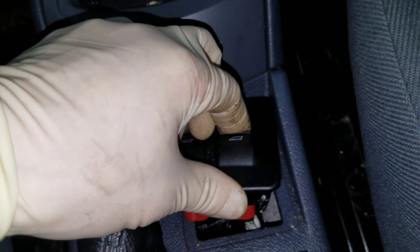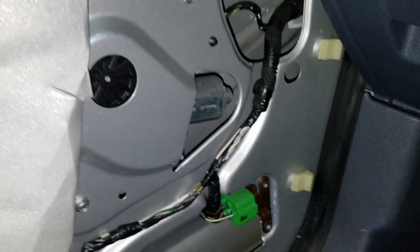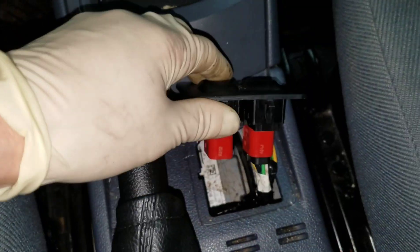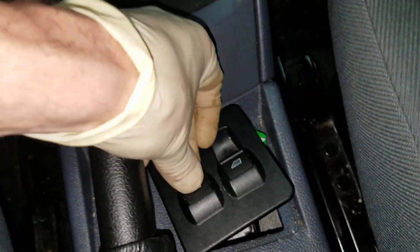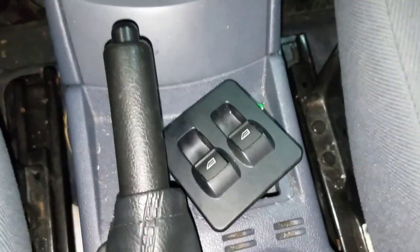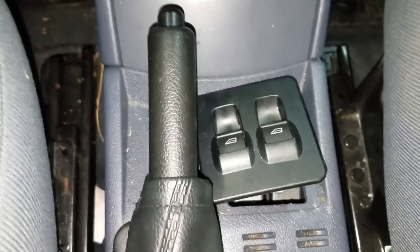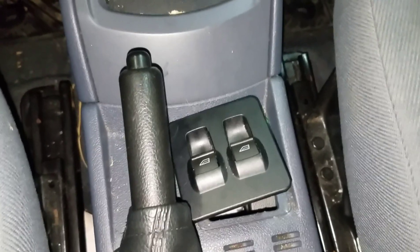We're going to go ahead and replace that switch. As a good test tip: if you pull the door panel off, the first thing you can try is just tapping the motor — sometimes you can even do it with the door panel still on to get your window up. If your switches are interchangeable you can try swapping them, though typically they're usually not. You can also jam on the switch quite a bit, since if those contacts are bad you can sometimes get the window up or down just enough until you can get it fixed. Hope this video was helpful — hit the thumbs up and subscribe to the Flat Rate Mechanic if you haven't already. Thanks for watching.